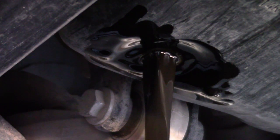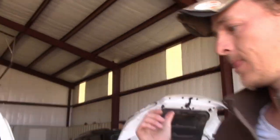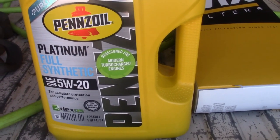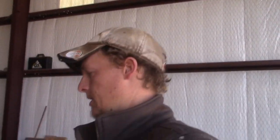People who say full synthetic oil can't get dirty — this is full synthetic oil right here. Oil is just about done draining, just leaking a little bit yet. And like I said, that is full synthetic oil — the same I have here. That was 5W-30 in there. I'm using Pennzoil — use the oil that you want but that's what I use. The full synthetic 5W-30 was in there, and I bought 5W-20 now since it's winter, just so the oil is thinner and warms up faster.